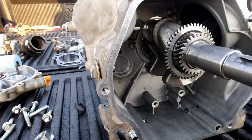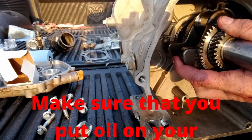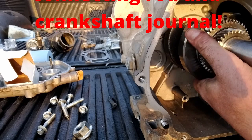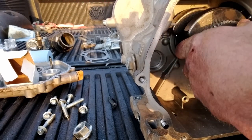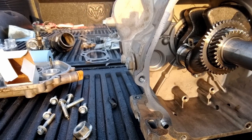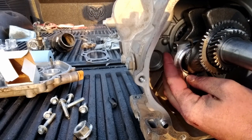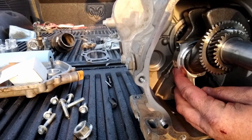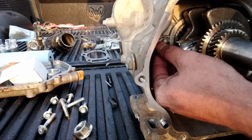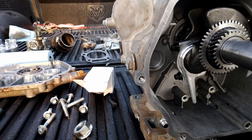Got her that time. Now we'll come back to inside here, pick up that rod. There we go. To right there where we can get her put back together. Got her cap. Dip her down, set it in place there. Got our cap bolts dipped in some oil, get them started. The other one started by hand, and we'll follow that torque procedure again.